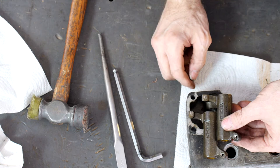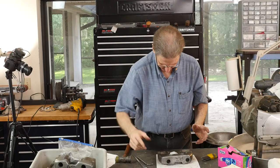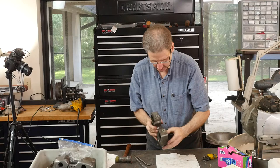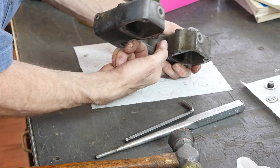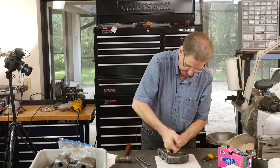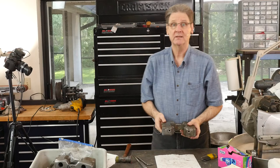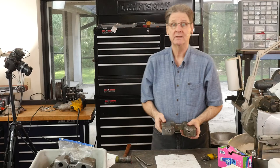If you swap them, you'd be squirting oil on the intakes, probably causing oil consumption and burning. So pay attention. There's also a big lip here — they only machined up to here and stopped. That's not good. So obviously taking that off would be good. And then you can feel here how thin the casting's getting — even getting it to 50 thou you might get some oil weeping from porous castings.